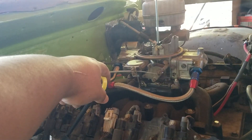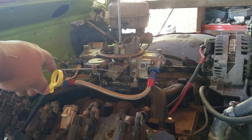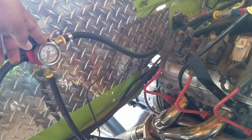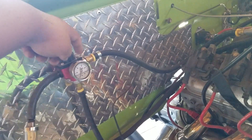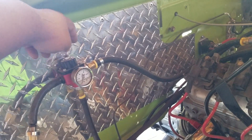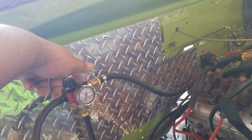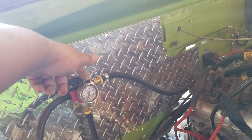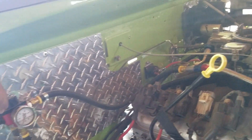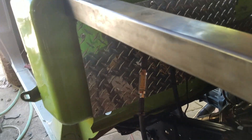For the LS, it takes a standard four-barrel carburetor. I've had an Edelbrock on this and it worked, and I've had different types of Holleys and they've all worked. For the fuel system, I'm using a TBI fuel pump with a dead-head regulator — you probably want to get a flow-through regulator because a dead-head is just going to blow up your pump. I converted mine to a flow-through, but I'm not using it the way it's supposed to be used. If you're running an electric fuel pump on a carbureted system, don't use a dead-head regulator.